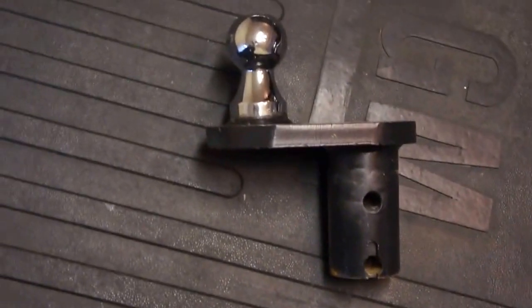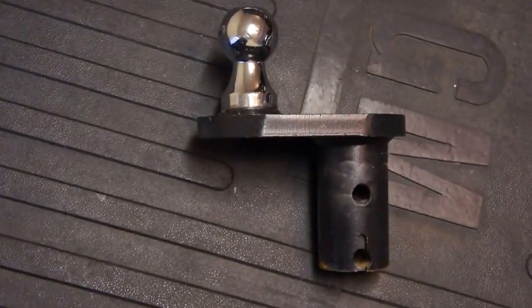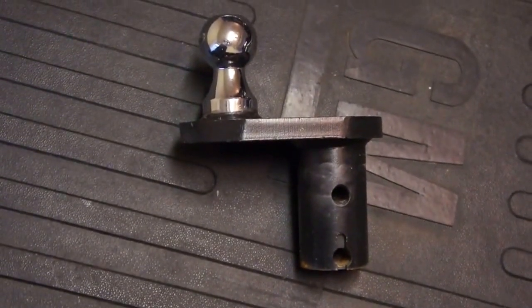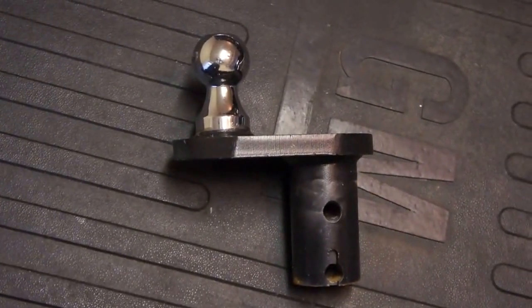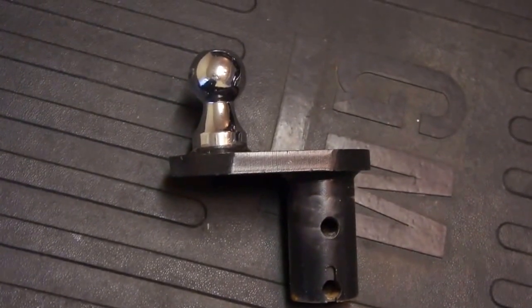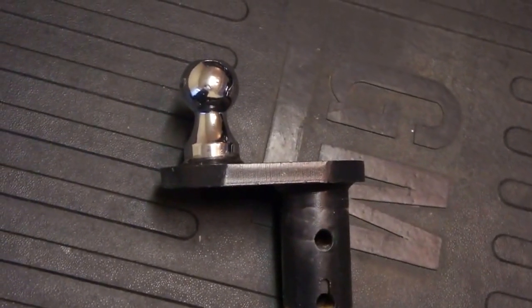So that tube to the right, where you see the 2 holes, that's what's going to drop into the cavity in my bed and lock in. That black tube sticking in, that's where the normal ball that came with the flip over hitch would go. So that does it, and then that moves my bed ball 4 inches towards the gate. Remember, I'm going to reverse the Kingpin adapter and lose 8, so I'm going to net 4.